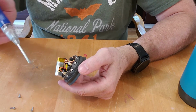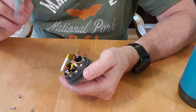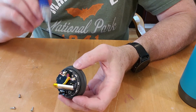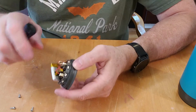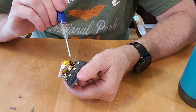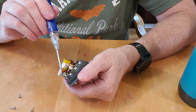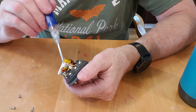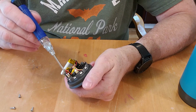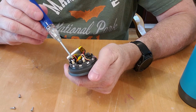When you do that, so that there's no possibility of touching, you're going to be fine. It's in a stable spot. It's never going to move. Another thing, you notice there's a red and a black wire. You cannot connect the red wire from the new battery to the red wire on the old plug and the black to the black. They reversed the stinking colors on these things.